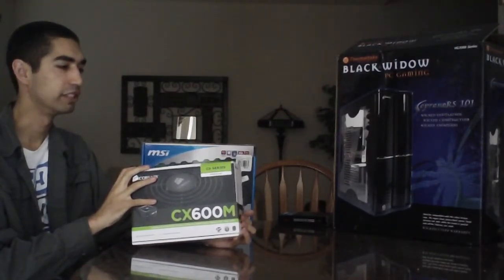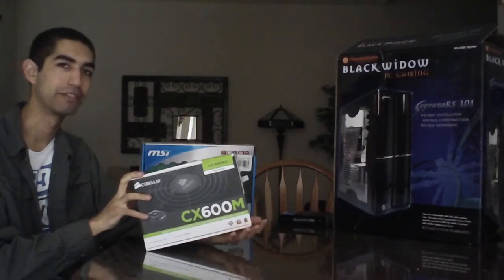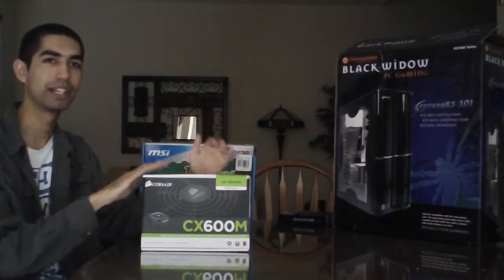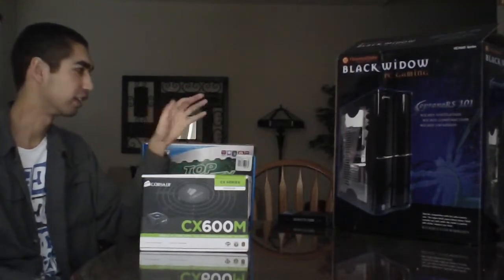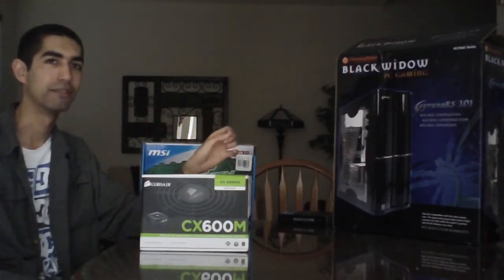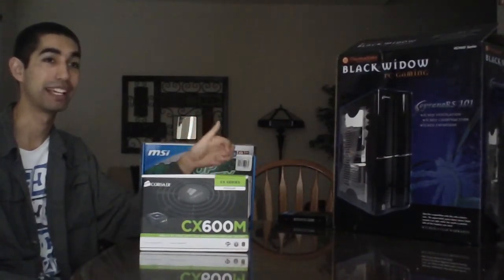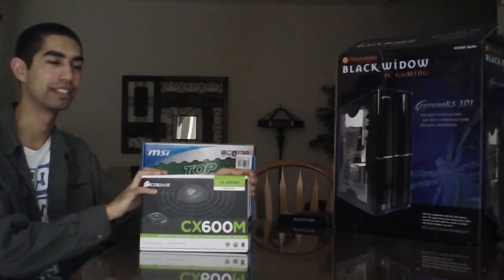The reason I chose this Corsair PSU is because I know it's a good brand with great reviews. You really have to look at reviews with PSUs — you don't want to buy a 750 watt PSU from a no-name manufacturer that only costs $30, because even though it may say 750 watts, it doesn't mean it can actually handle that load. Those PSUs tend to be cheap in manufacture, and if you're putting in a nice CPU, good motherboard, and RAM you love, do not put in a cheap PSU. A bad PSU with poor voltage regulation can fry your components, which would be far more expensive to fix than just buying a decent PSU.